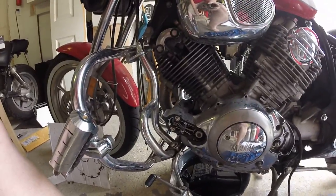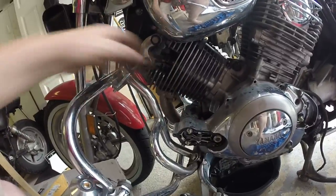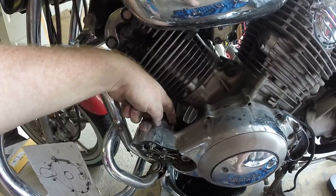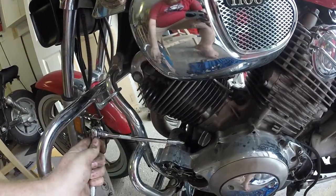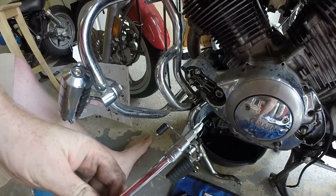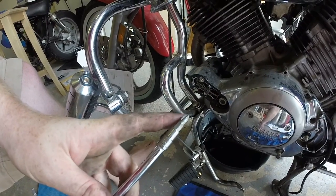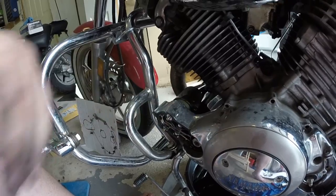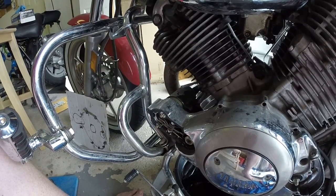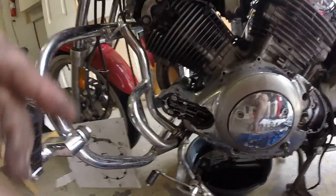I've gotten the clutch off and the cover for the starter. There are two Phillips heads facing this way — one here and one here — and one feels almost entirely stripped, so I have to be very careful. Getting in there is tight, so I'm using a 6-inch extender. A tip: if you don't have a Phillips attachment, a quarter-inch bit will fit different screwdriver heads. I ended up using a 6-inch and 4-inch extender together from the other side because the angle wouldn't work otherwise.